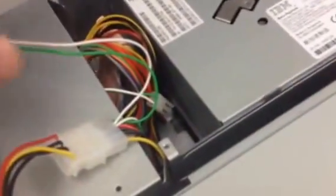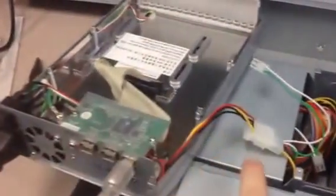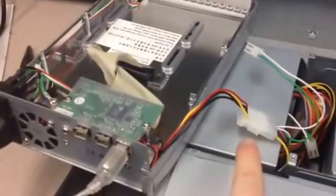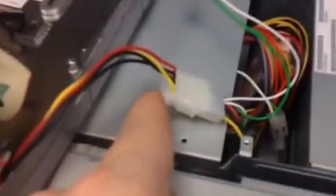Fortunately, if you look back here, you will see that the 124T tape drive uses a standard Molex connector to receive power. So we took off the case top here, exposing all of these components. Remove the three screws from this unit so that we can access the autoloader mechanism. Then we used one of these external hard drive bays that has a Molex connector on it. If it's one of the new SATA bays, they may have the SATA power on it, so you have to use an older IDE model. We also used a Molex extension cable because it was a bit hard to fit the cable back down in here.